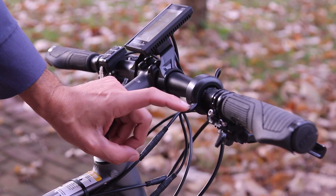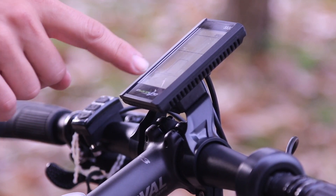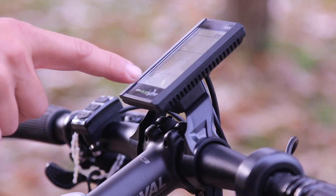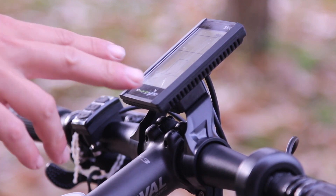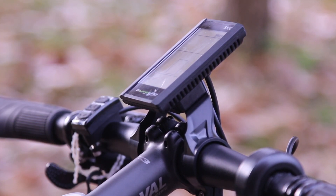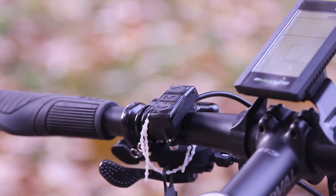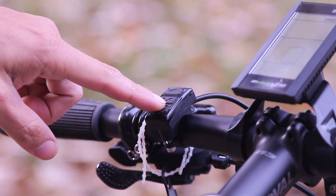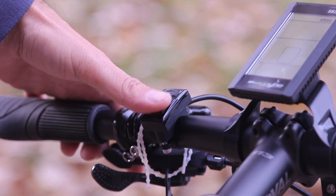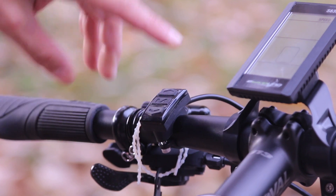The owner of this bike is 5'2", so her hands are a little bit smaller. I was surprised how good the computer looks. This is the eBikeling S830. They have instructions online and it's very important because you do have to program it. If your motor is not turning on, chances are you probably did everything right — check the connections. To power it on, if you have the battery on, you should be able to push M and it'll power on.